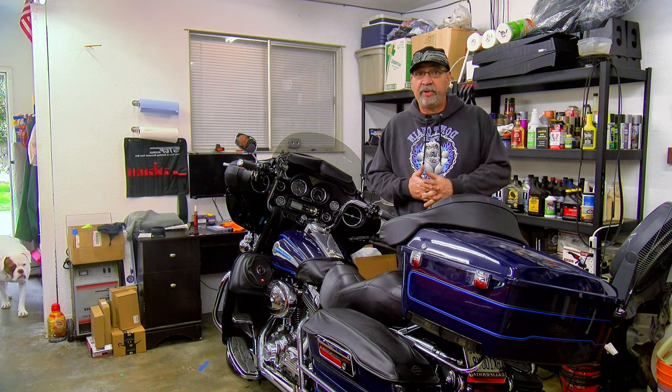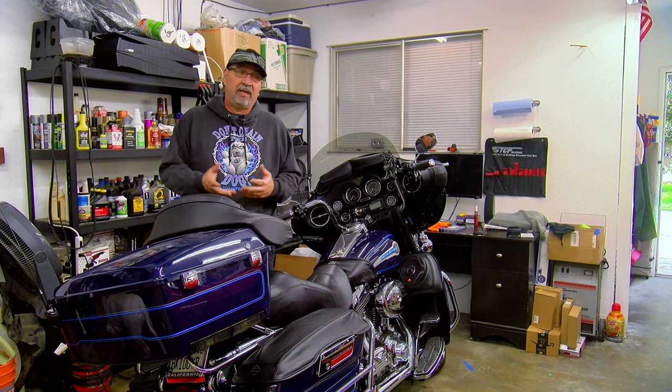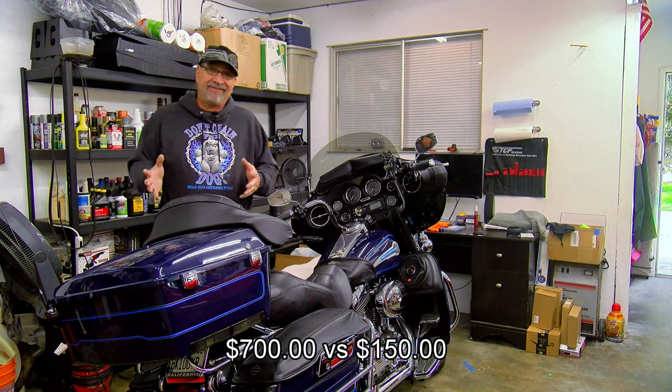If you want more quality, you can purchase Rockford Fosgate speakers at about $400, then have Harley install them — probably about two hours of labor at $100 an hour — so you're looking at least $700 out the door. $700 versus $150 — I'll take $150 any day. With patience and determination anybody can do this. One important thing: you can't just buy any speakers. Harley-Davidson uses a two-ohm system, so make sure speakers are two ohms. It doesn't have to be JBLs — you could get Hogtune 7-inch boards — just make sure they're two ohms.